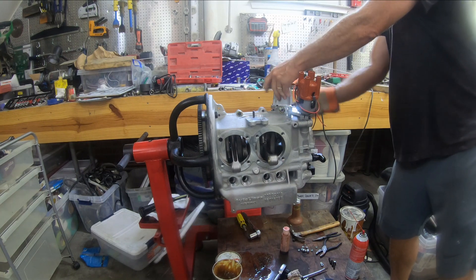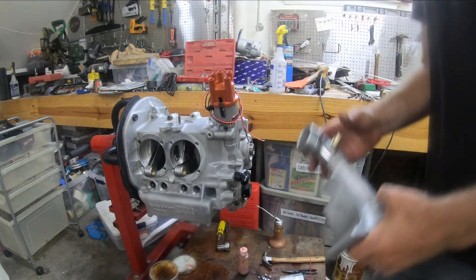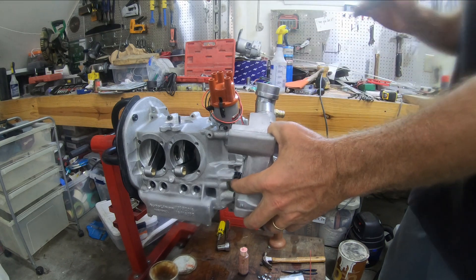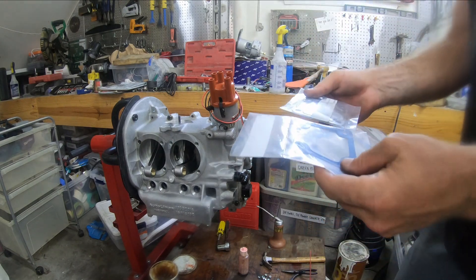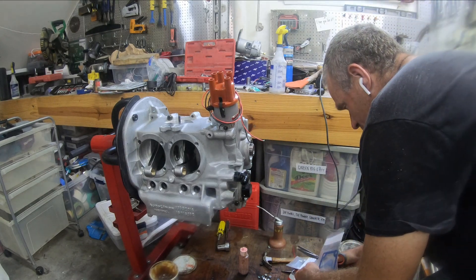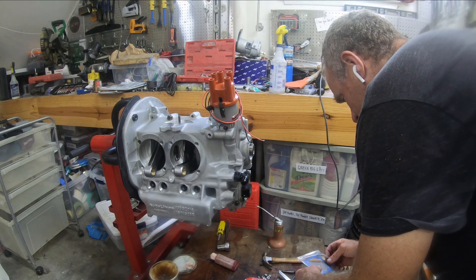I'm going to get the gasket and put this guy on there. I know I'm doing some of this a little bit out of order because I'm waiting for my head studs and some other things to arrive in the mail. I went ahead and got this as tight around as I can make the oil filler, and I think that's fine because then it faces out of the engine compartment when you're filling it. Then I've got my gaskets and everything for the oil filler, and the little baffle. I'm going to go ahead and open this up and use Permatex Aviation on there just to make sure nothing leaks. I have two gaskets and the little baffle.